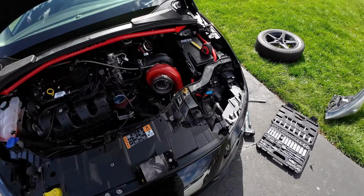So this is the 6AN fitting, or the adapter, that'll run it. And I'm pretty sure that this is going to fit. It matches up pretty good. Yeah, that matches up really good. So this should fit it. If this doesn't fit, I don't know what size it is, but I guess this is it right here. If I can focus, hold on. So it's 6AN, 14 by 1.5. That is it right there. And I can link that down below if anybody's doing anything similar.